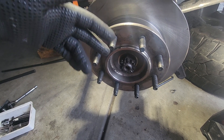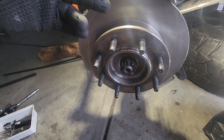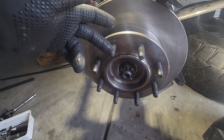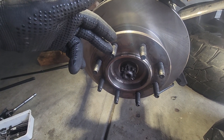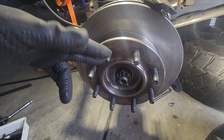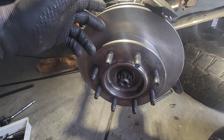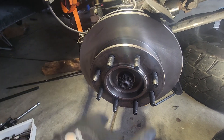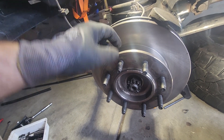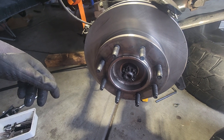For $250 I'd rather spend a couple hundred more and get a good part that's gonna last longer than a year. Once you do it over and over you get pretty good at it. Now that I figured out how to disassemble this and put anti-seize in all the right places it comes off like a charm. I could probably do brake pads, rotor, and everything in 30 minutes tops if I didn't have to disassemble this hub, because you've got to hit all these bolts and there are four in the back that attach from the axle to this part.